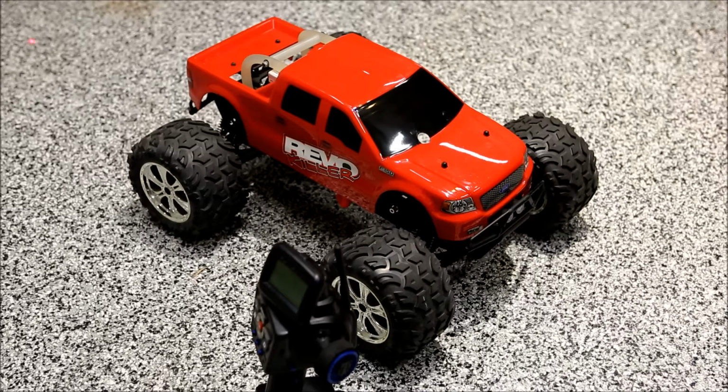I have modified the engine to where it'll actually accept a different fuel mixture. It's 32% Nitro and 18% Amsoil and then 15% E85. It is a OS 30 VG, and originally those come with about 3 horsepower stock. With all the mods and everything, I've dynoed it at 6.8 horsepower. I had the heads ported and polished, or the head, sorry.